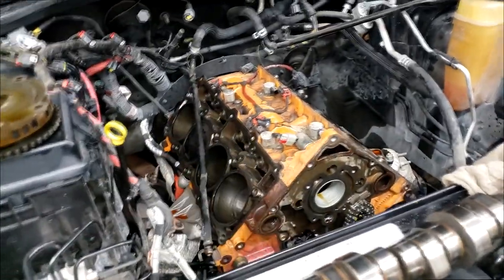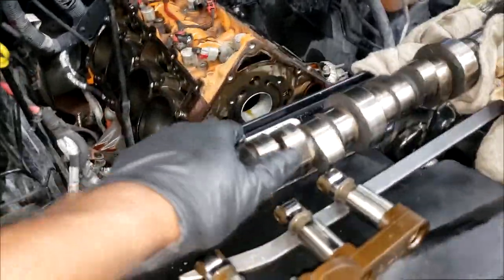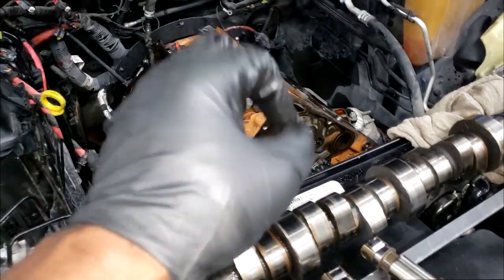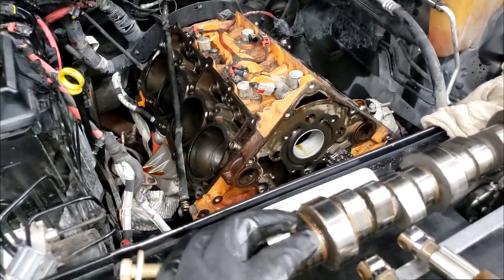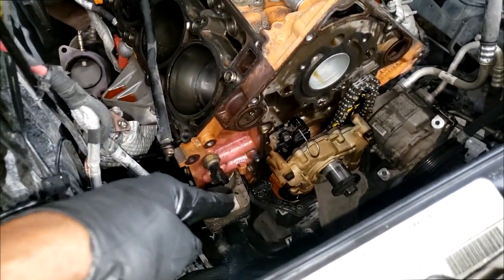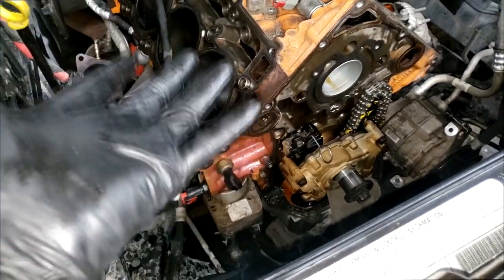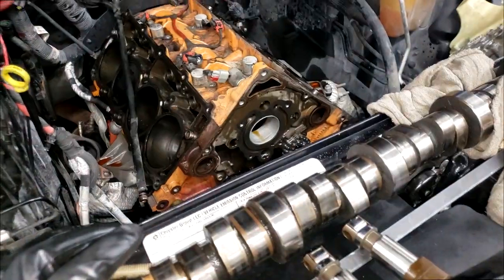Okay, like I say, the best way to do it is to remove the oil pan, because I want to think these shavings are pretty heavy. So they're going to slowly fall and work their way to the bottom of the oil pan. Guys, if you hear right here, you don't have much. You could try to get some out through here if it's magnetized. But the best way, like the way we do at Brothers Motors, is we remove the oil pan, okay?